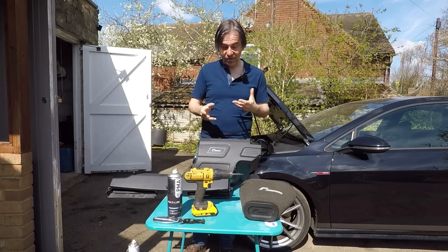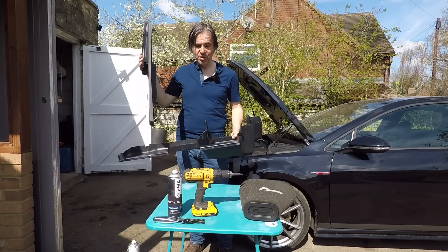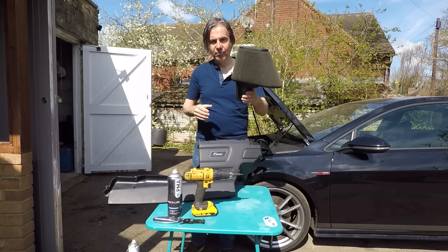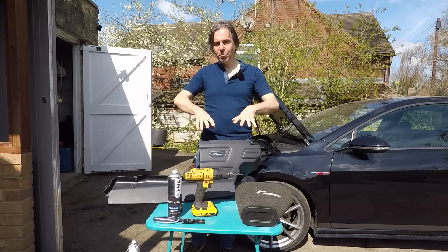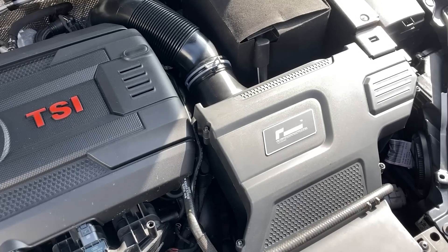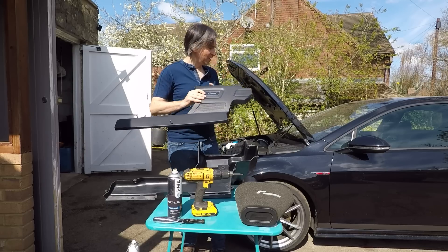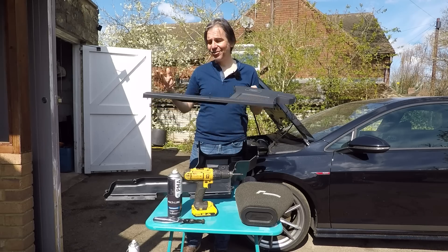The reason it works so well is threefold. Instead of just one air intake at the front, we've got two — meaning more air gets into the air box. We've also got a bigger filter that has twice the surface area of the factory filter. And it's made from the same PU plastic that the original air box is made from. It's not particularly glamorous, but it looks really high quality. It's been designed to match the engine cover on Mark 7 and 7.5, and most importantly it's the best material for insulating heat — it gets very, very hot under the bonnet and you don't want that hot air anywhere near the inlet tract.